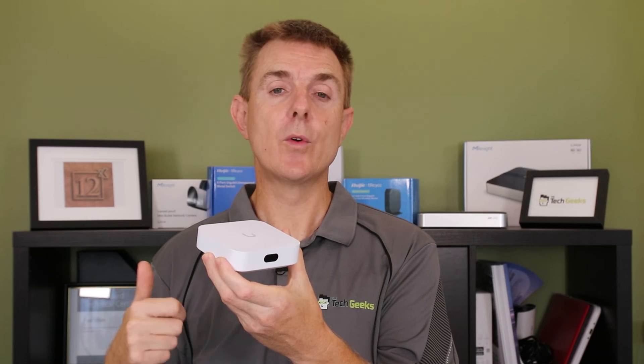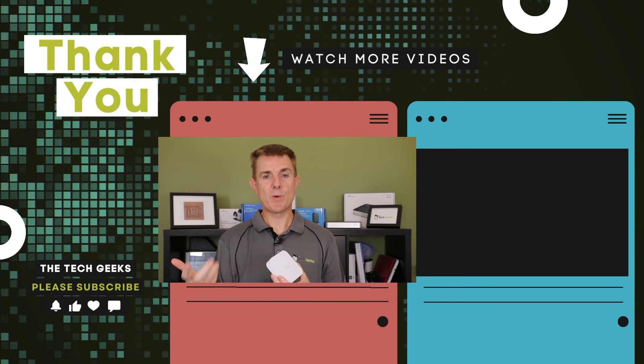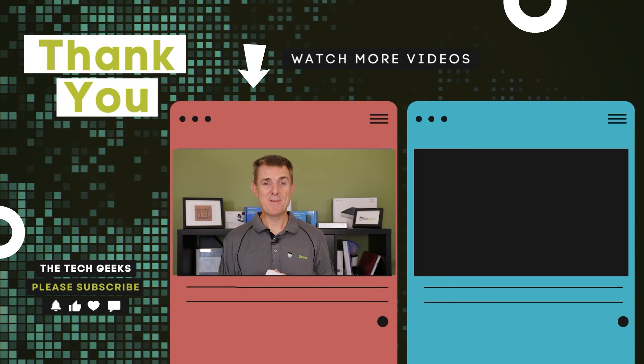Obviously that depends on whether you turn on any services like filtering or intrusion prevention. On the wireless side, through about 12 meters and two or three concrete walls, we were able to get 30–40 Mbps. That is subjective and there are ways to optimize performance, but as a guide I would probably place these every 10 meters or so and you're likely to get a good 150 Mbps or more. Remember it is only two-by-two so it is limited in total performance. Hopefully that's given you a quick idea of what's in the box — head over to our YouTube channel and check out the other video: what do I need to run UniFi Express. Subscribe and stay up to date.